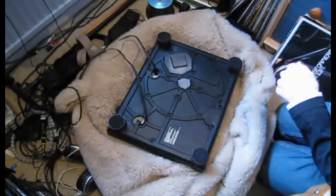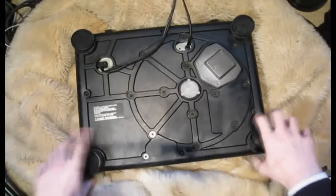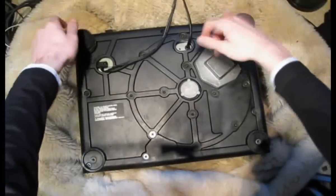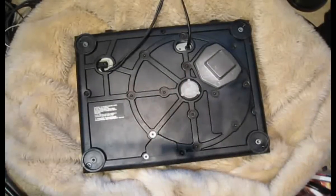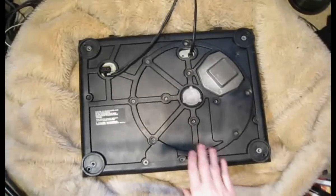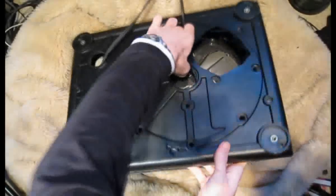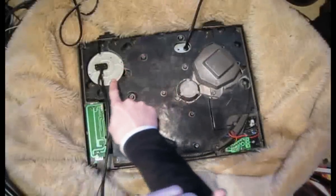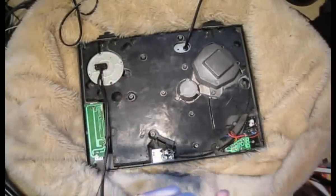Now the first thing you've got to do to get this bottom off is to screw all the feet off. Then you've got to take all these screws out. There's a link in the description to another video of mine where I actually go into a bit more detail about how to take these screws out, so if you're in doubt, nip to that and have a look. Now all the screws are out, you can go ahead and take this rubber piece off. Now that's off, you can just take this plate off and start working on the tonearm, but I'm going to show you an easier way.